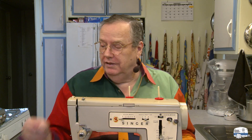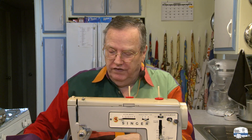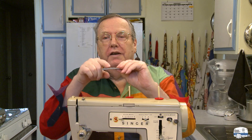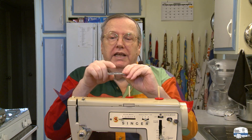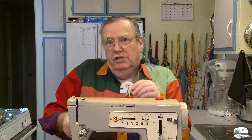It's a great machine because it's all steel inside, no plastic. One piece that came with this — I don't know whether you call it a throat plate — the teeth go up through these grooves, the feed dog, the feed teeth, which feed the fabric through the machine. This raised plate holds the fabric above the teeth so it doesn't affect the fabric, which is useful if you don't want your fabric to move — such as when you're zigzagging a button into place. On newer machines there's usually a lever in the back to lower those teeth, but for this one they provide this plate. So this machine is ready to give away.